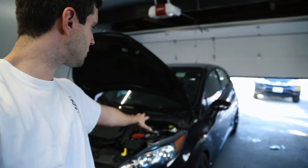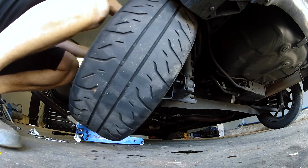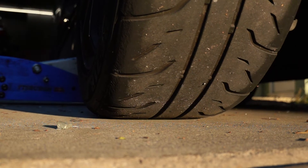I finished bleeding my brakes going from the right rear to the left front, just like any other brake bleeding procedure. I made sure my fluid was topped off and my brakes were firm at the end after a test drive. I really like the speed bleeders — at the track, all I need is my bag and fluid to bleed my brakes super quick if I boil them over at Laguna Seca or Thunder Hill. Check them out, see if you have M7 or M10 in the rear, and make sure you subscribe and check out the description below.